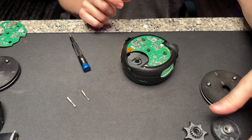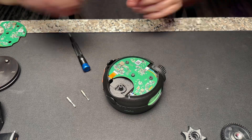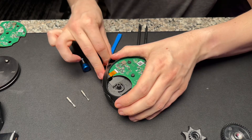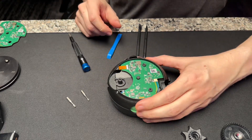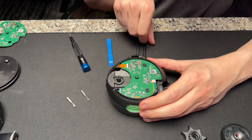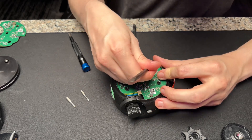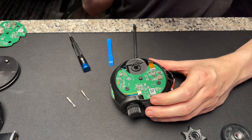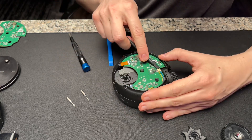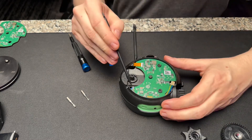Here's where you have to be very careful, so I'm going to show you exactly what to do. I have some tools ready because I already took the other one apart. You have to disconnect this cable very carefully by lifting off the black side of the panel — the connector — and it will slide out. This comes off really easily; it's just a flat power connector, so you can just click it off. These are the same cables for the motor.